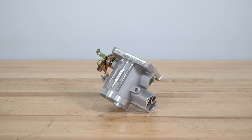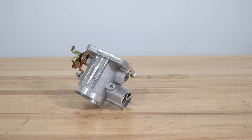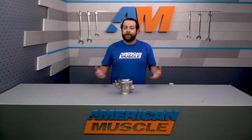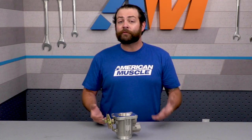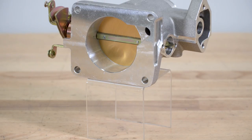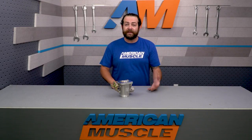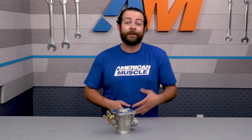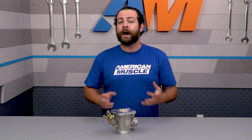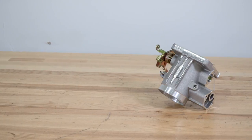While throttle bodies aren't mods that make gobs of power on their own, when paired with the aforementioned modifications, they really will add more power that can't be found elsewhere. And in the long run, we're all hunting for bigger numbers. The Mustang's factory throttle body comes in at around 56 millimeters, and BBK's is 70 millimeters. While the bigger diameter sounds like a small upgrade, it's actually a big step in the right direction — but bigger doesn't necessarily mean better on its own. If your motor is completely stock, this is not going to do much for you. But if you're investing in exhaust pieces, an air intake, maybe an intake manifold or even other power adders, that OEM throttle body will quickly become a bottleneck. This throttle body fixes that, freeing up the extra air your motor needs to take advantage of those other mods.